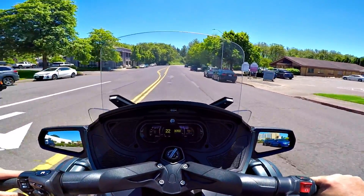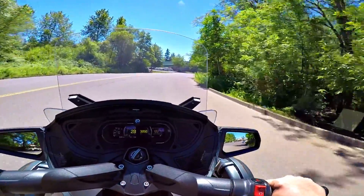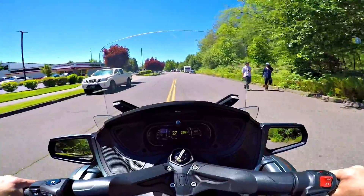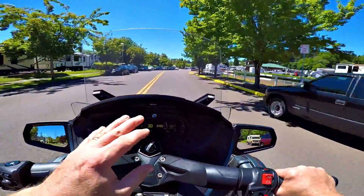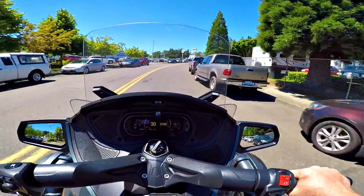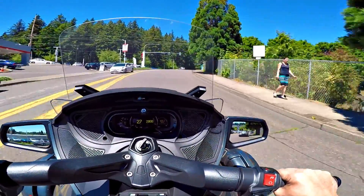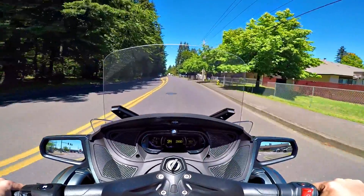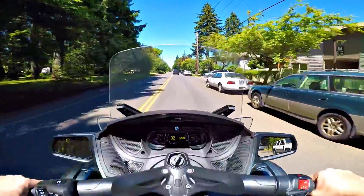I realized Ryan did the UVI on it — I just had to do the alignment. It's a good thing I knew it had low miles, because it was very odd they didn't bring me an oil change kit. That could have been one of those deals where you drain the oil and don't change it. Don't change it early like this — first service is at 3,000 miles, that's meant to be that way on purpose. You're the first loser putting it bluntly — there are reasons they have you keep the oil in there.